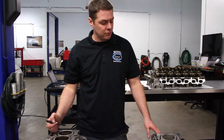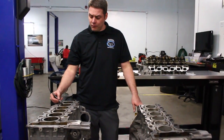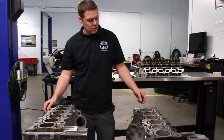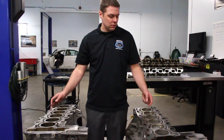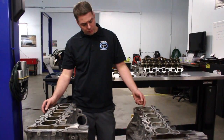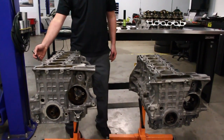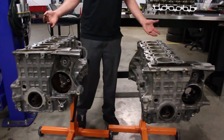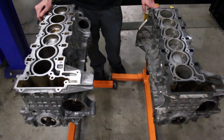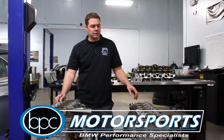To sum it all up — N54 versus N52: N54 has a steel liner, N52 does not. N54 is an 84-millimeter bore with an 89.6-millimeter stroke; N52 is 85-millimeter bore with an 88-millimeter stroke. N54 is all-aluminum block; N52 is aluminum with a magnesium outer case. N54 has a forged crank and larger rod and head bolts; N52 has a cast crank with smaller rod and head bolts. Completely different casting design on the exterior, including coolant port location and oil drains built in for the turbo. Obviously the N54 is stronger all the way around. How strong is the N52? We're about to find that out with our turbo kit — like and subscribe, and stay tuned for more updates and further development of the N52.